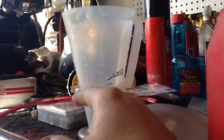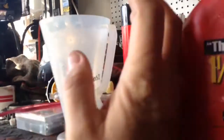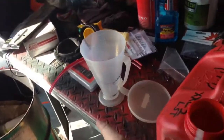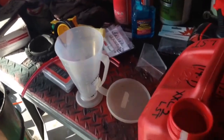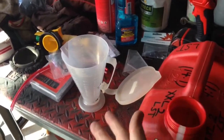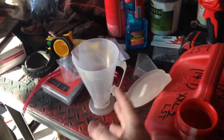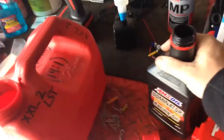After breaking in new motors, I'll do another fuel mixing video. But let me tell you now: after the whole gallon of 24 to 1, you want to run 28 to 1. I don't do 25 to 1 like RTR motors say — I do 28 to 1, whether it's for racing or bashing. A bunch of us have been doing this. I have a six-year-old OBR motor for a reason. At 28 to 1 you get the best performance, more power, and they never overheat.